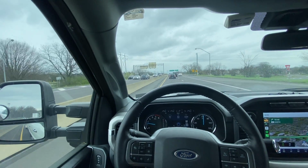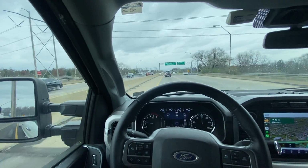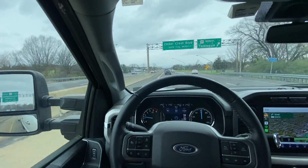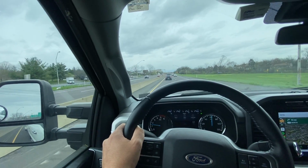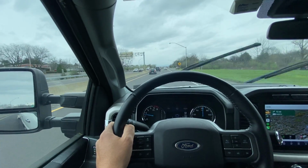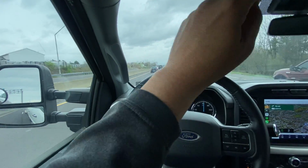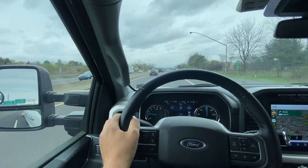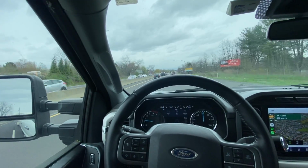And the problem with the engine being at that low of an RPM, again, is that it takes a certain amount of horsepower to push the truck and trailer uphill at a certain speed. And that required horsepower increases dramatically with speed because of your drag, which increases not just in a straight line with your speed, but goes up exponentially or parabolically or whatever.